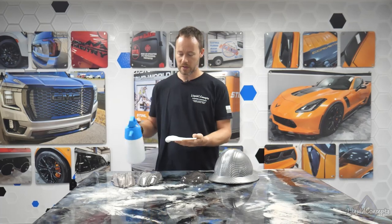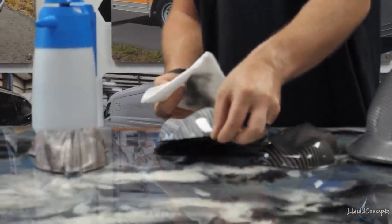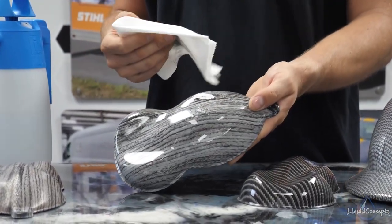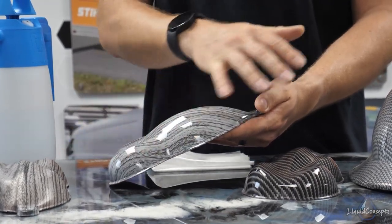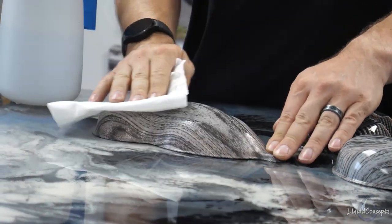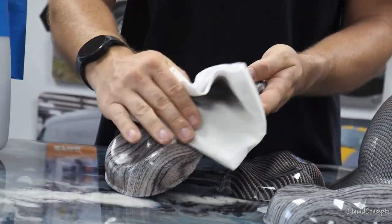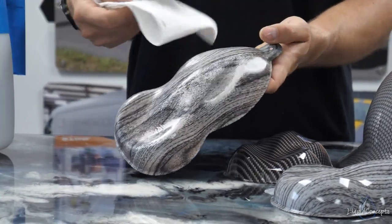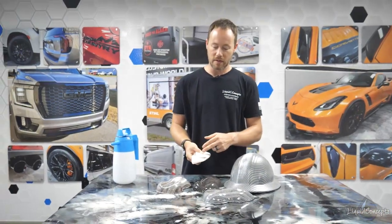Same thing with this one here — it's more of a flatter finish, not a dead flat, but it still offers the same protection. We can take this and rub it and again we don't get anything off. Now we'll take this uncoated one, spray a little bit of isopropyl on it, and the first time we go to wipe it off you can quickly tell we're already starting to pull the print itself — the inks — off of it, and we're back down to bare paint or even all the way down into the primer.